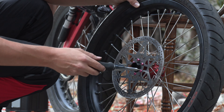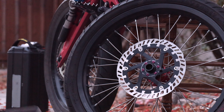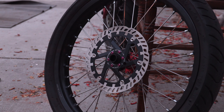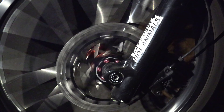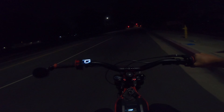Right off the bat, I'm not a fan of the Lunar Rotor — listen to this. I'm well aware how to align the brake caliper; I have a tutorial on it. I straight up think they made this rotor way too thick — it rubs up against the caliper housing itself, it's not even the pads. And these are stock calipers. The rotor is just so thick — look at that, it's just barely clearing.